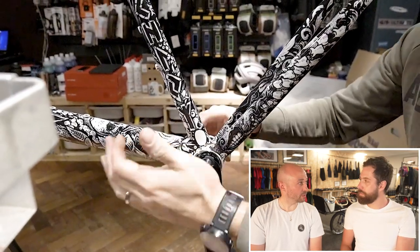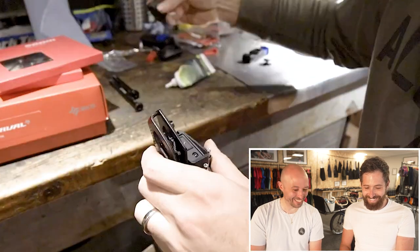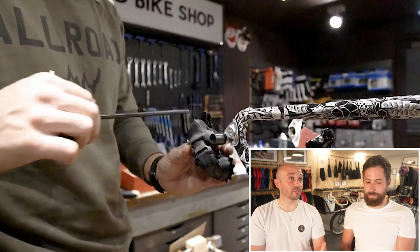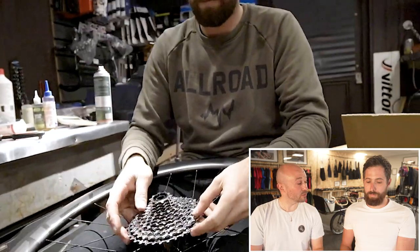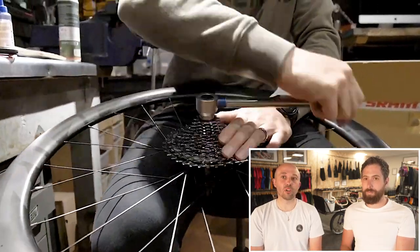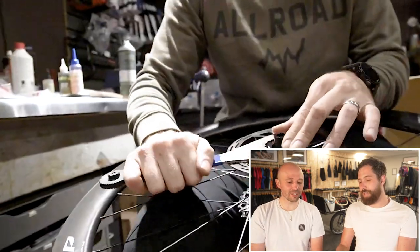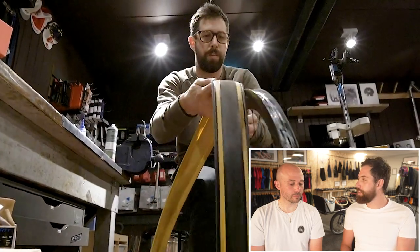You get to literally spec what bottom bracket because they're all built to spec — we'll talk about that in a future video. It's a Rival groupset, hydraulic all the way through. I'm a big believer that there's never a scenario where you're riding and you think you've got too many gears. So it's actually a gravel gear ratio on a road bike, which I figured made sense. I've got no intention of riding fast, so it works for me. And the beauty of that is you've got a double on there, but it's quite easy if you ever decided to switch to a single — just take the front mech off.